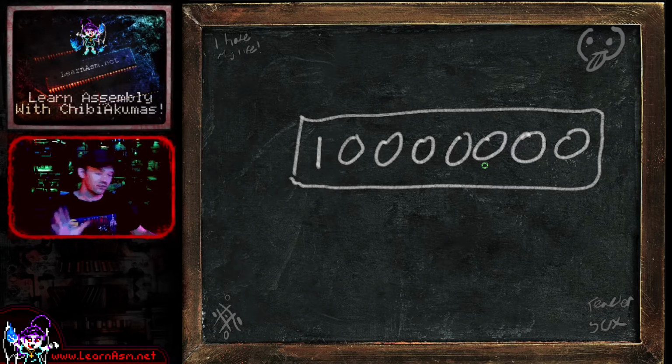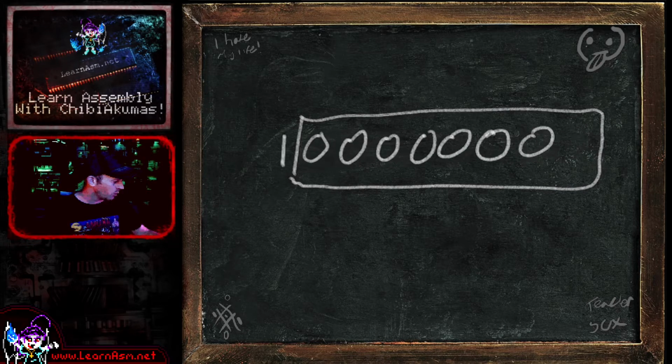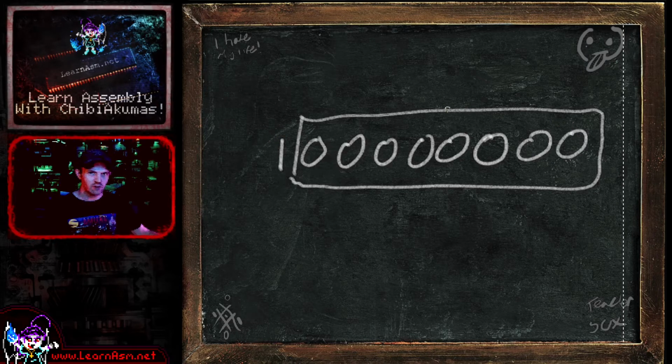We're going to cover a lot of this later on, so don't worry if you don't quite understand that. But if we've got a value like this and we decide to rotate it to the left by 1 bit, well, we might see something like this happen. We'll shift by 1 bit here, and a new 0 bit will be inserted here, possibly, depending on the command we're using. But 1 bit has been pushed out of the byte, and that will be pushed into the carry on most processors. So that's another function of the carry.